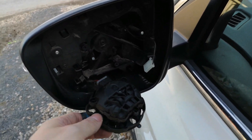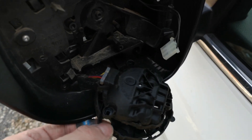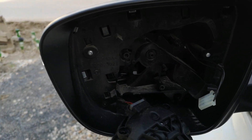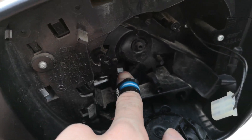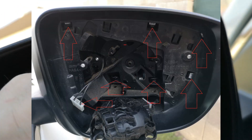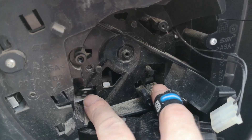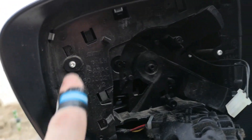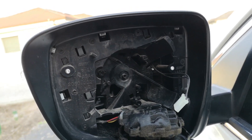After the three screws are out from the mirror engine, I recommend putting the screws to the inside because I already lost one and had to use a spare that doesn't fit 100%. Learn from my mistakes. Now you need to remove the white part of the mirror. You only need to care about four clips in the corners and the two bigger ones — not the others. Two hands needed — release the smaller ones and it should come down easily.